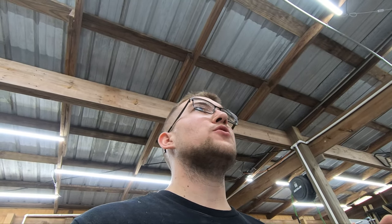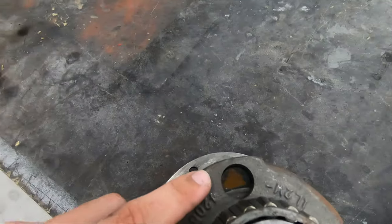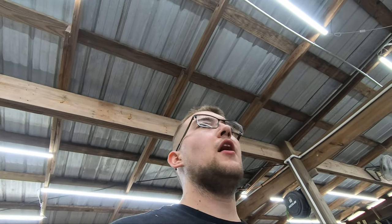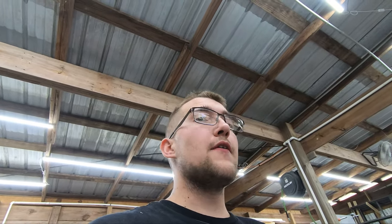That groove is not a big deal to me. The axle nut is what retains it anyway — you can just pop it out. It's more of a safety feature, and most people don't use it because an IRS center section with that feature costs around $800. Also, if you run a spool there's nothing for it to clip into anyway. Back to the point — I have two center sections: one is a limited slip differential, you can see the clutch packs, and the other is an open diff. The 8.8 center section was 28-spline up until around 2011 in the S197 range.